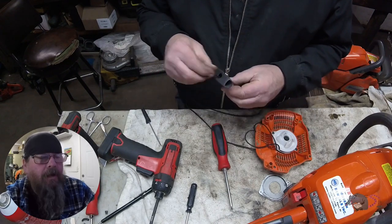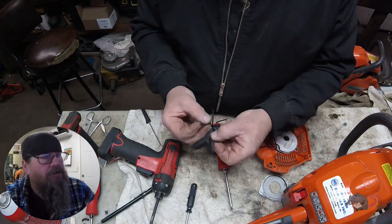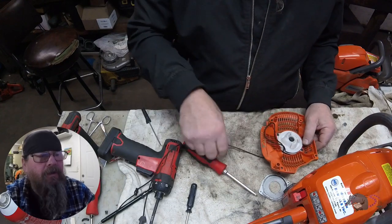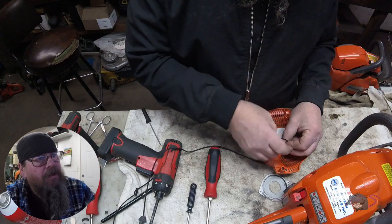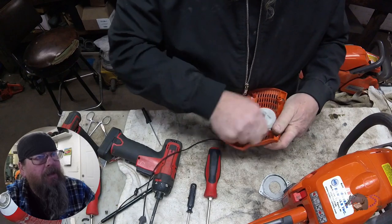Because we don't know the length of the rope, we're just going to put a loose figure eight knot on the end of it, just so we don't lose it if we put some tension on the spring and the rope slips out of our hand or something like that. Now you can see I'm able to wind the spring — I've got about four turns on there — then we'll let it wind up.